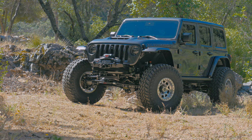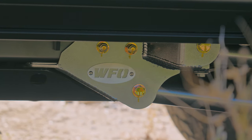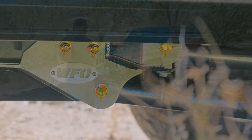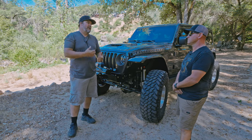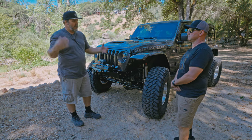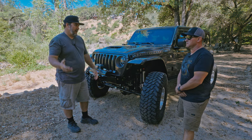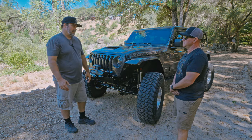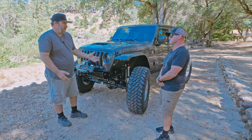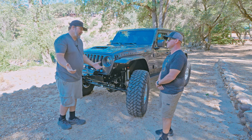I've been talking about this, and you're the perfect guy to answer the question. These are all-wheel drive, we still have the all-wheel drive transfer case in it, and you're driving it in all-wheel drive still. Correct. Hubs locked, correct? Yep. The internet engineering says if you have a U-joint in the front and you're all-wheel drive, when you accelerate in sharp turns, you'll get steering wheel chop, pulling in and out of parking lots and such. I know you've only had it a couple hundred miles, but have you felt anything enough to make you say, I need to spend $3,000 or $2,000 on RCVs? No, not yet, not at all. So it's 1550 joints. I feel the same way on mine. I haven't felt anything. At some point I'll probably put in RCVs, but it's not a must.